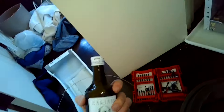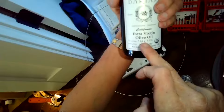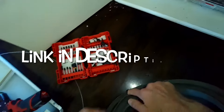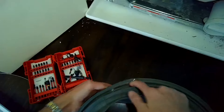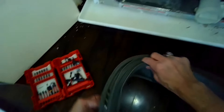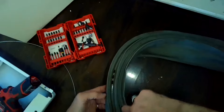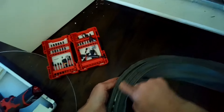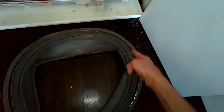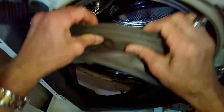What I'll do next is use some lubricant. This time we're just using virgin olive oil, but you can use liquid laundry detergent — anything slippery is going to be great. This just makes it easier for the rubber gasket to go into the plastic tub. If you don't use a lubricant it's a lot harder to get it to slip on. Usually liquid laundry detergent works great.